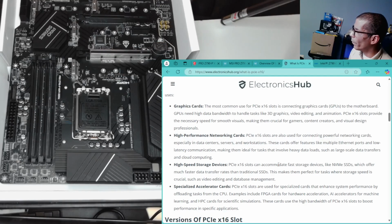in your PCIe slot. Now, not because you have or you don't have PCIe 16, you're going to be limited to installing an additional card for storage purposes. It's just simply that you're not going to have the maximum throughput to take advantage of what that card is providing to you. So your experience may probably be reduced by the speed of the slot, and that's why it's important to get to know your motherboard, because